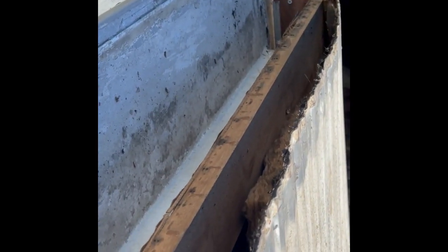I've cleaned up significantly on the top and taken it basically back to bare metal because you can see the paint is crap, so it's all going to have to be sanded back. And doing this roof, I'm trying to work out a good way to get up there without actually getting on it, and that's not going to be easy. If we had the facilities nearby, I reckon this whole van needs to be sandblasted. So it's actually something I'm going to look into, because it'd be a whole lot quicker to sandblast it after I've done all of the sealing, and then work on just priming and painting much, much quicker.